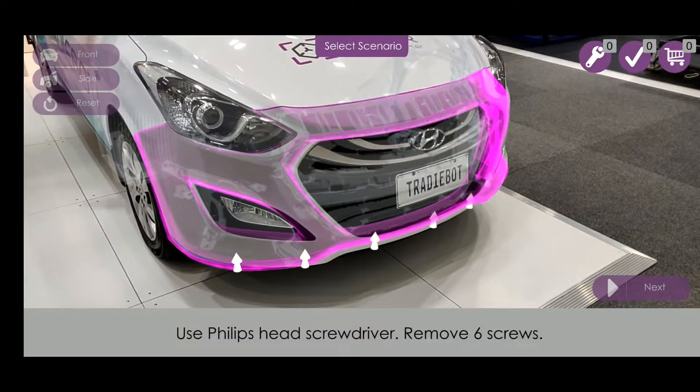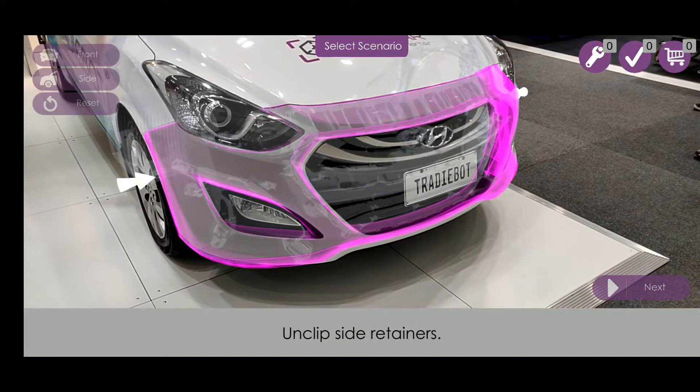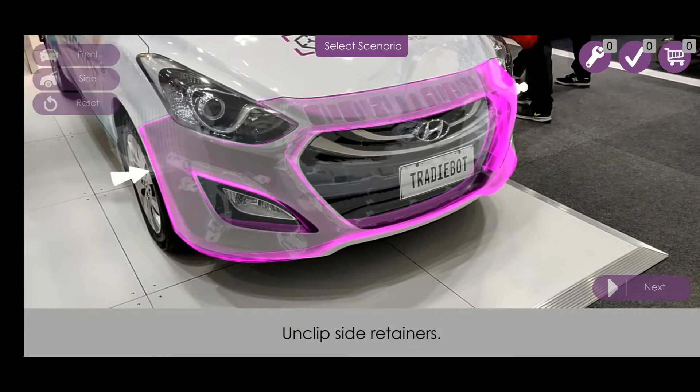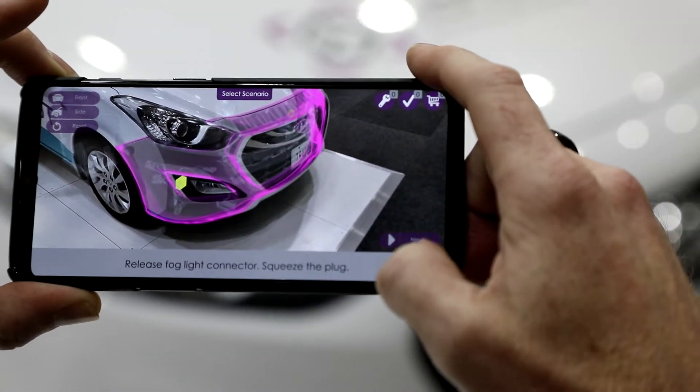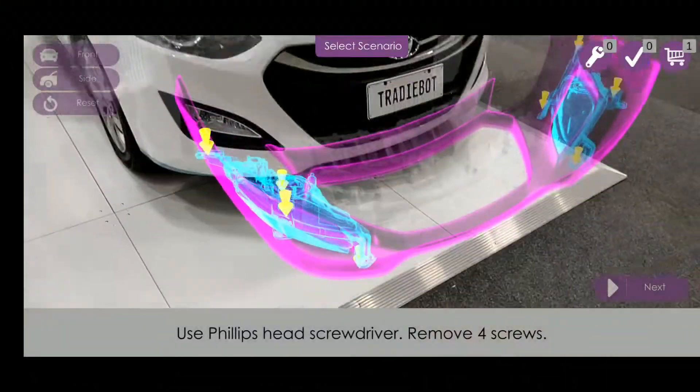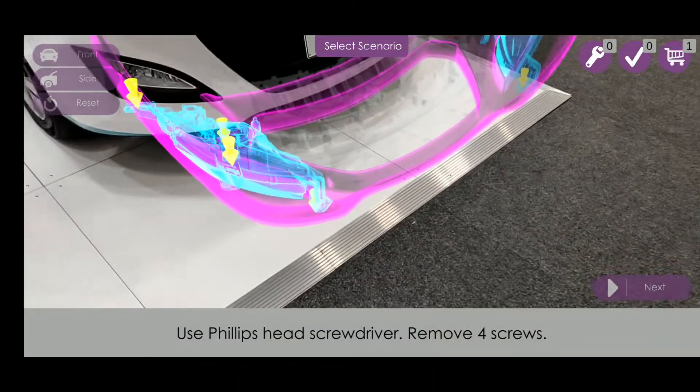Address the 4 sides and underside of the bumper. Unclip the side retainers by gently pulling the edge near each wheel arch. To remove the fog lights, use a Phillips head screwdriver to remove 4 retaining screws.